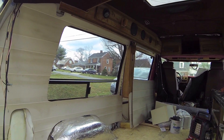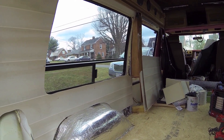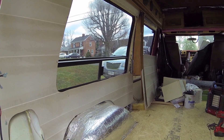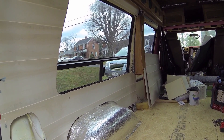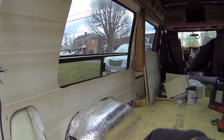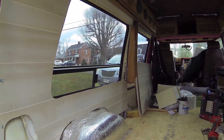Here is the paneling on this side — I haven't done the other side yet. I did this last night after I put in two-by-twos around the windows. There's such a gap that I couldn't just put it up on the ribs, since there's only one here and one there, so I went ahead and got some two-by-twos and also one-by-twos. The sides are smaller up top and bigger at the bottom, so I had cut some one-by-two for the top and two-by-twos at the bottom, but that wooden piece is in the way and I didn't account for that when I did my template.